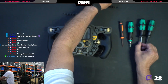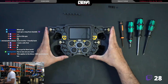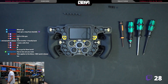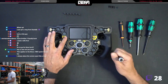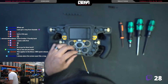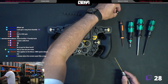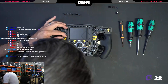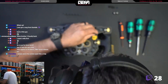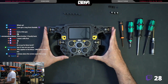If you're slow and deliberate it'll be no problem. You can semi-lift the face off now, and this is where a lot of people get confused. That's because you need to get rid of the three funky switches with a 1.5mm hex. Just get the set screw off of each funky switch — basically a half turn — and then it'll come out. Be careful not to strip those set screws because you won't be able to get it off the wheel.